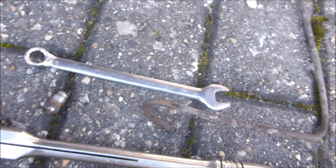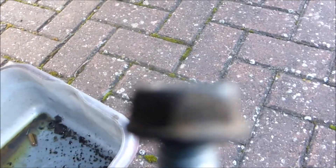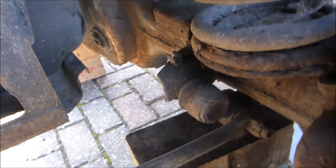It goes onto the rubber flexible hose over the back axle. I've taken this one off — there was one difficult end I couldn't get off. To get access I've taken the whole assembly off. You'll find there's a long M10 bolt with a shoulder on it which holds it onto the bracket on the back axle. The brake union nut on the other end came off using the single hex Snap-on spanner — snapped it off nicely, but extremely tight and very difficult to break the joint.